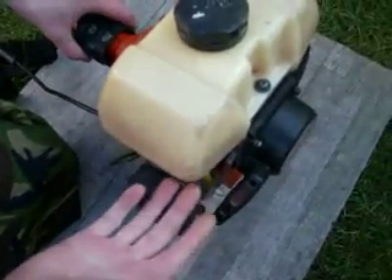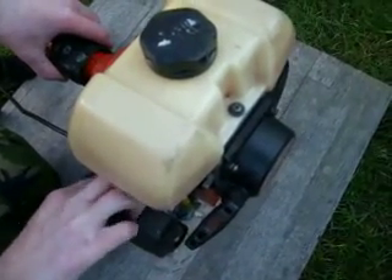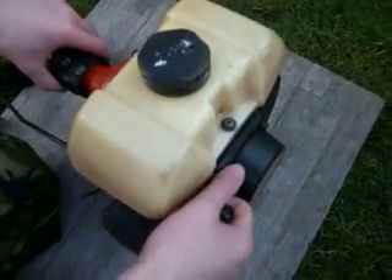When you start in the morning with the choke fully on, it'll start for a couple of seconds and then cut out. So take the choke off then, and leave it for about half a minute to a minute to warm up — and away you go then, cutting grass.